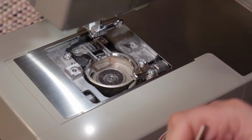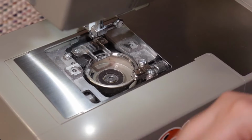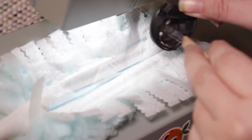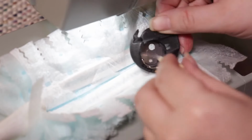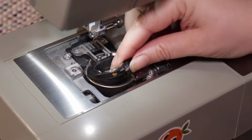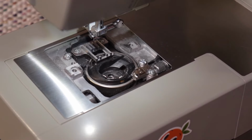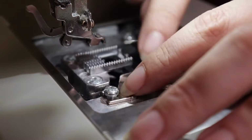At this point, you should be pretty clean. Take a final look, get any remaining debris out, and you're gonna wanna grab the actual black bobbin housing, give it a good brushing, and prepare to put the machine back together. Grab your bobbin housing. There's a note on the front that denotes which way is front. It should gently set back in.